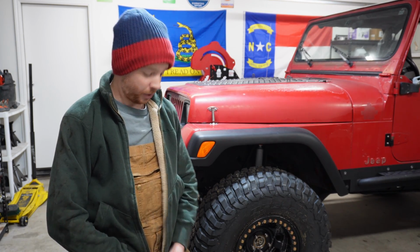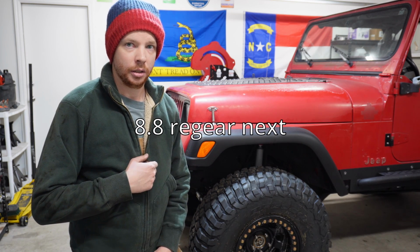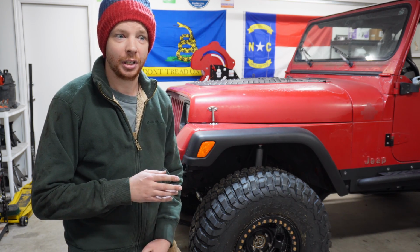All right, it's kind of late and it's kind of dark outside, but I gotta drive it. I gotta know if it's gonna make noise. I'm so nervous. I'm gonna run it in two-wheel drive, obviously, and not put it in four-wheel drive, but I'm still gonna do the break-in as if the whole thing was regeared. So I'm gonna drive it for like 15 minutes, park it for 30, drive it for 15 minutes, park it for 30, that kind of thing.